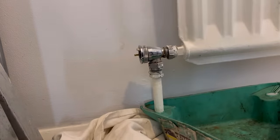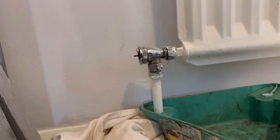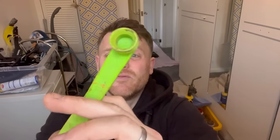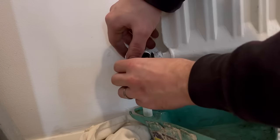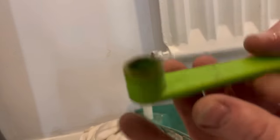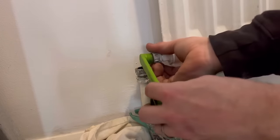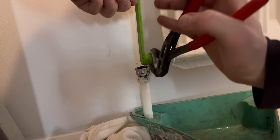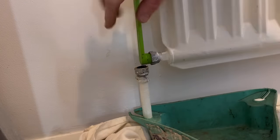There's still a bit of water left in there — it's been draining for about ten minutes but you always seem to get a bit left in the rad. These are another handy tool: plum forms. These tighten into the radiator and stop them from leaking as you take them out. There's a fat side and a thin side — half inch and three quarter. I'll use the half inch side; be careful not to cross-thread it as it's plastic onto metal. Get it on there — locked in place. You can actually use it as a handle as well.